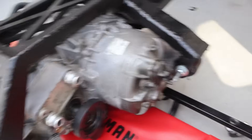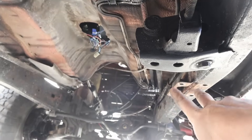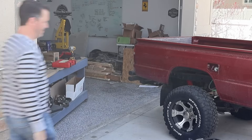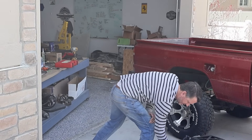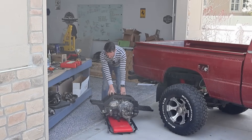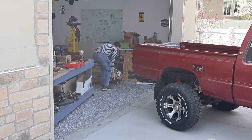We got the motor and motor mount down — it's on our creeper so we can move it around. The new plan is we're still going to use those same mounting points on both sides, but we're actually going to move the motor up as far as it will go, giving us about an extra three inches. The new frame will actually be higher than the original transmission mount. Now that we've got this off, we're going to put our new plates on and start some welding.